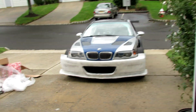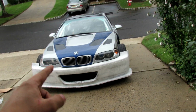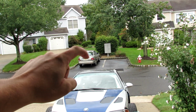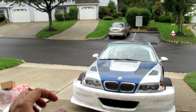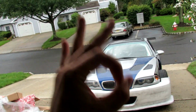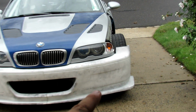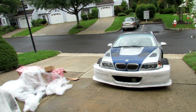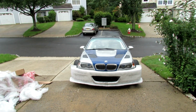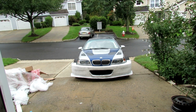That's what I was talking about, the bumpers now joined together and everything. So is the rear bumper right there. But I'm just going to take it off because I'm going to take this car to Walmart to get coolant for that car, because everything's good, it just needs coolant now. And to get more brushes and a grinding wheel for the Dremels. Because to make those fine kerf cuts right here, I'm going to need the Dremel more, because the grinder can only really make straight cuts, you can't make good tiny corner cuts with it. And then I think the bumper will look more normal, because it's ridiculously wide.